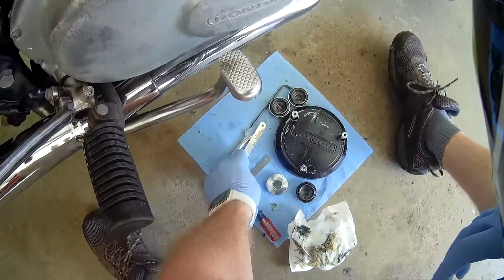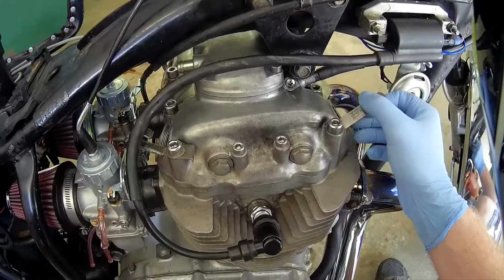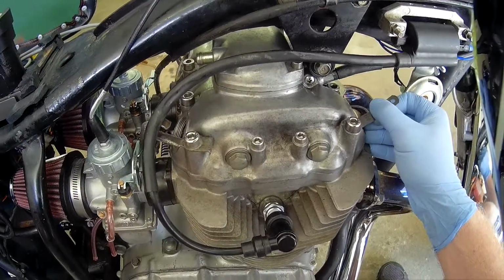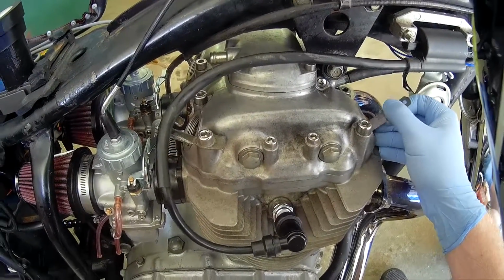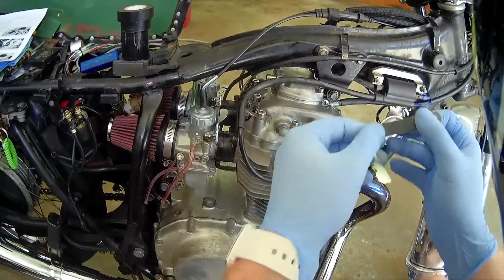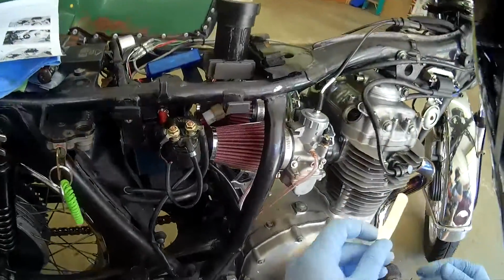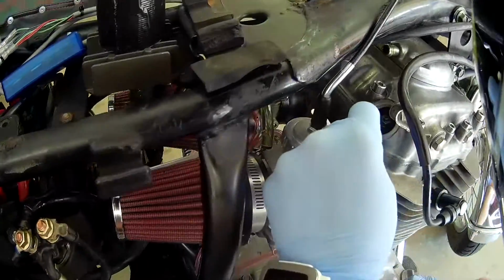A little bit of drag, and a very wise person on a forum told me they use the go no-go method. So I've got the next biggest, and I can cram that in there, but only just. I mean, that's very close. I'm going to call that good. I'd rather be a hair too loose than a hair too tight.